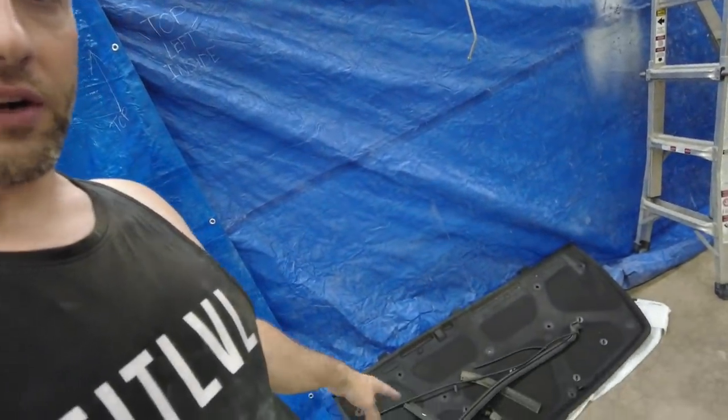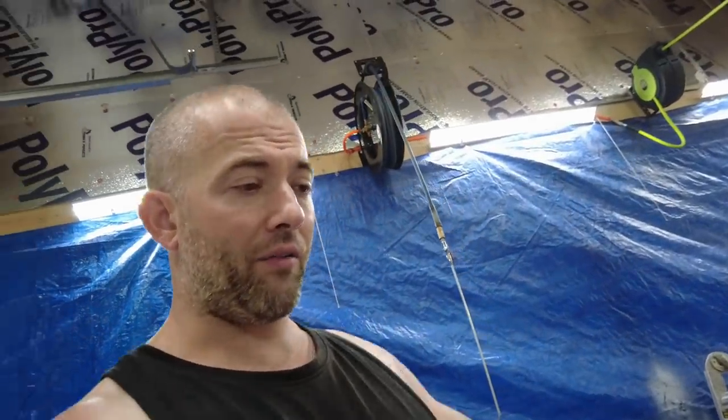I want to do the underside of the hood just like I did on the Avalanche, and it's already stripped, so I'm gonna quickly scuff the bottom side of that, maybe with some Scotch-Brite. Not the whole thing, just around the edges where the cover here doesn't cover, so that it's not a red hood when you pop it and it's a white car, you know what I mean? And I'm leaving the hinges on it because we're gonna spray them white too. So I'll get back to you after I charge the camera and the memory card, and we'll get right back onto this.